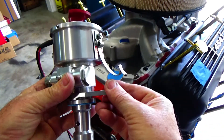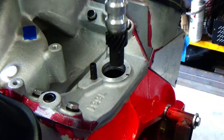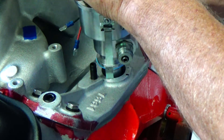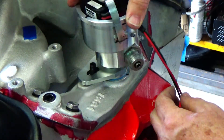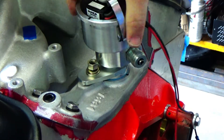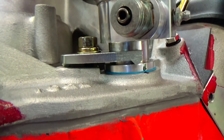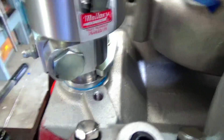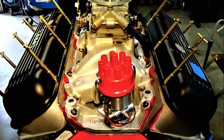The holddown fits well now. Go ahead and set that distributor down in there. Just so everyone knows, the distributor is going to come back out one more time when I prime the engine, so this isn't the final install — it's just fitment. I'm going through everything to make sure everything fits well, so when I do finally install it for good I won't have to worry about anything. The holddown looks good; distributor length, height, and everything worked out well. We've got the end play set and the gear mesh worked out. If you enjoyed the video, hit that like and subscribe if you'd like — we appreciate you guys watching and hope to see you on the next video.